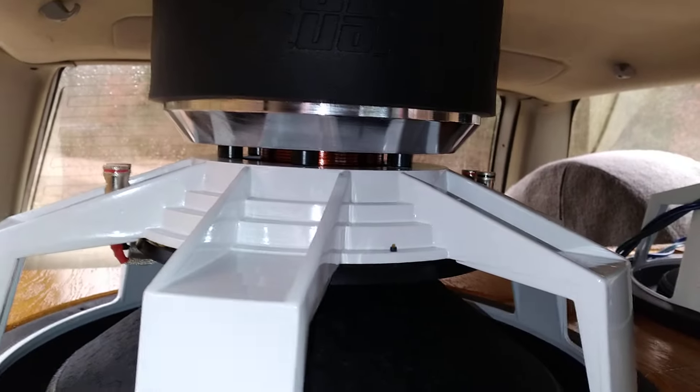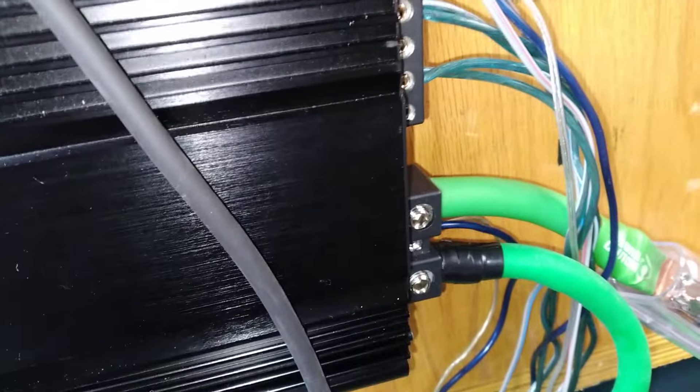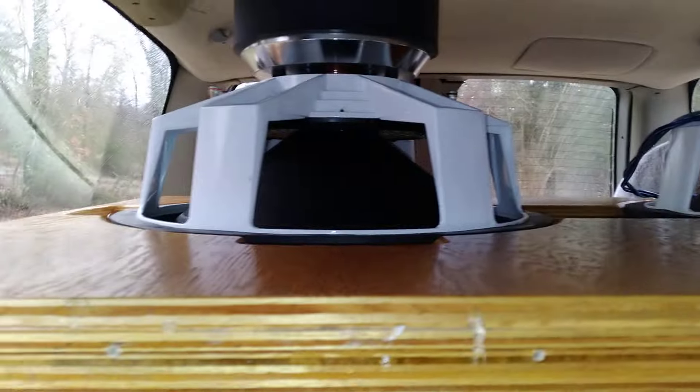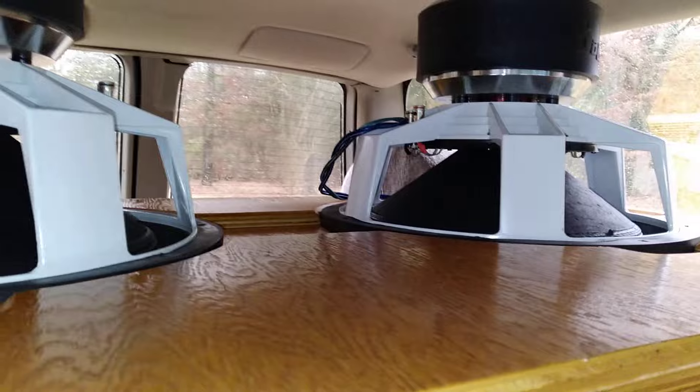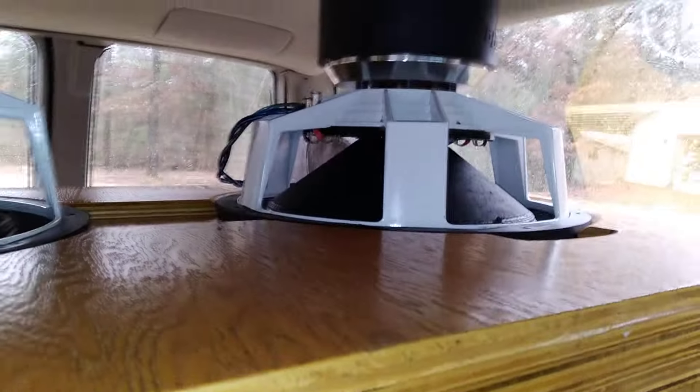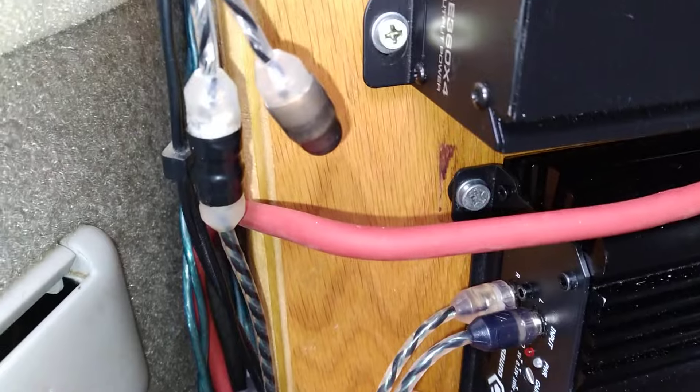What's coming on my channel? I'm gonna add another amp — two amps per subwoofer, two amps strapped to two ohms. I'm actually gonna test strapping two of these amps at half ohm and see if they sound good. If they don't, I'm going to series wire these subwoofers and have two strap amps in series. These are dual one ohm, so that'll make it two ohms strapped, which is one ohm per amp. I'm gonna put that amp, when I get one, right next to this one — I might have to move this amp over a little, then put the other amp right there on my subwoofer box.